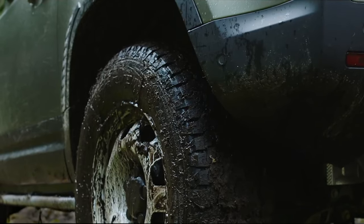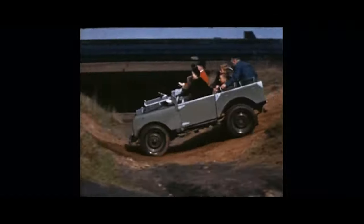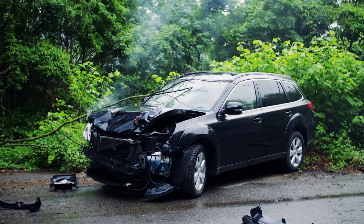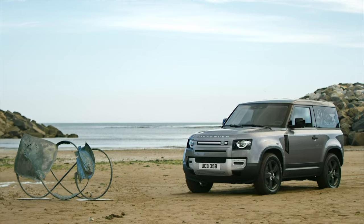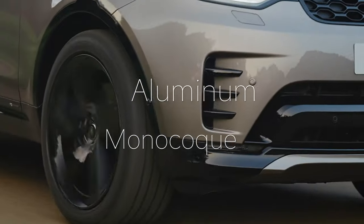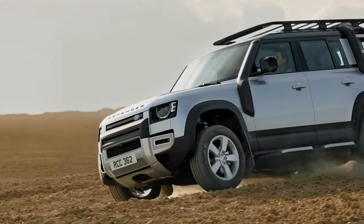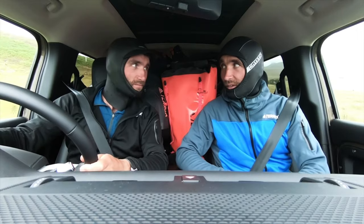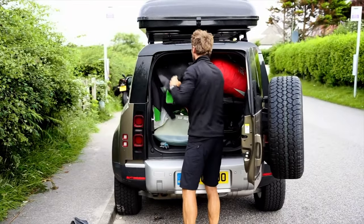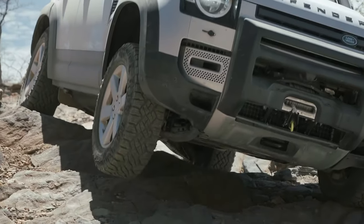One of the biggest changes is the chassis and suspension. The old Defender lasted for decades with its body-on-frame configuration, but while a solid frame might seem to guarantee safety, in an accident there's a high chance the body will fall off the frame with unpredictable consequences, and the body itself is less rigid. The new Defender uses a stiffer version of the aluminum monocoque found in the latest Land Rover Discovery and Range Rover models. The monocoque body weighs less, providing more carrying capacity and interior space, and in contrast to body-on-frame design, it carries both tensile and compressive forces within the skin, including special collision-deformable zones to increase passenger safety.